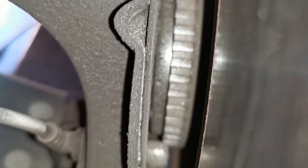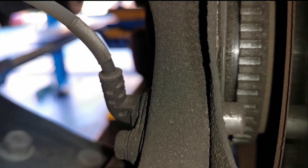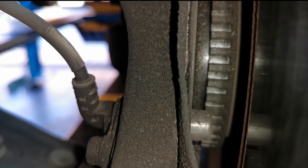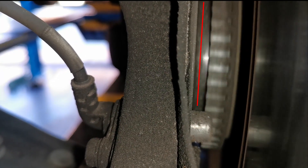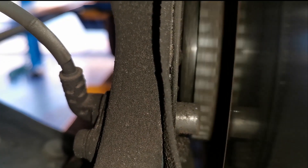Here's a better look at the front side — that is the reluctor ring. I highlight the wheel speed sensor and if you look there is a clear gap from the inside to the outside. I highlight that by putting some red lines in, and when I spin the wheel I show you where the reluctor ring should be sitting versus where it actually is.